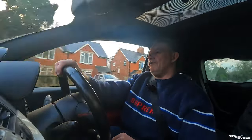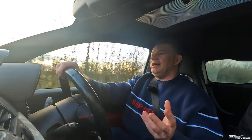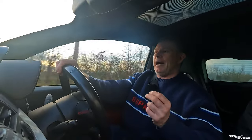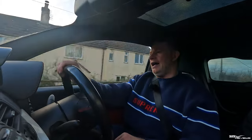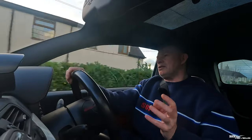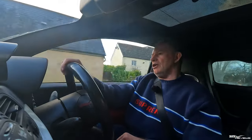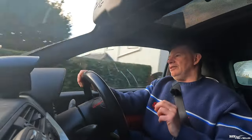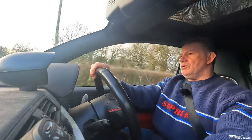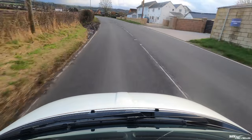The SS kit provided additional performance and an additional map into the ECU — the ECU was replaced with a new SS ECU. The suspension and brakes were upgraded too, though I actually downgraded the springs back again because it was just too harsh. I put the original springs back on, but the larger discs on the front have proven beneficial, and of course you get the bigger wheels as well to fit over those larger front rotors.